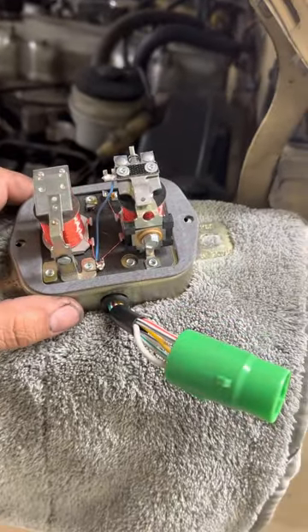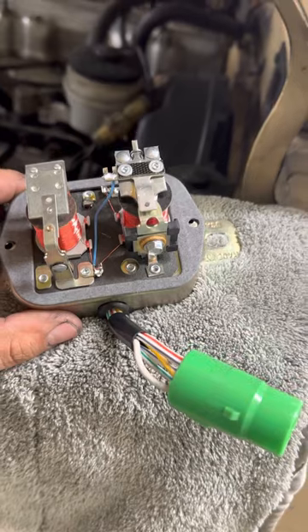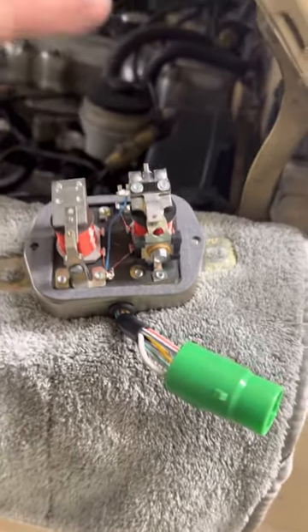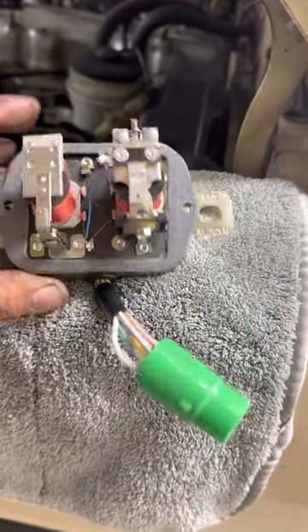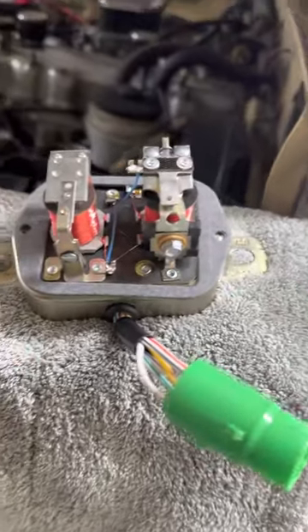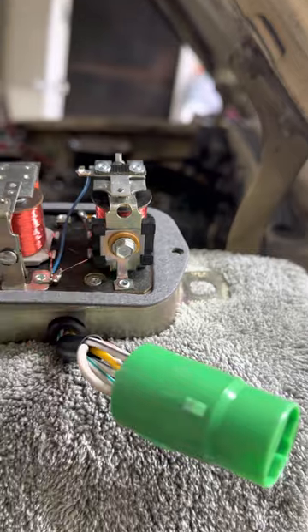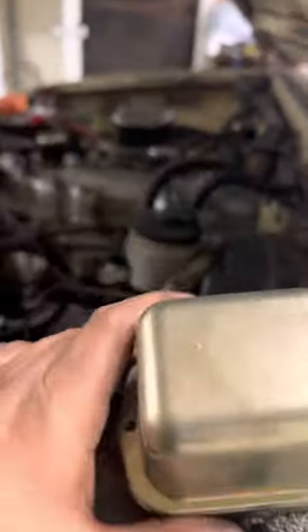Because this one is actually for a Toyota Celica, Toyota Pickup, and another Toyota SUV as well. So I'm assuming they're calibrated to a certain voltage. So I found out that — because I was having a headache trying to figure it out — anybody having an issue with this aftermarket one: just loosen that little bolt and you can adjust and have your voltage set to whatever you want.